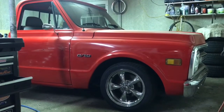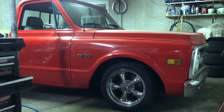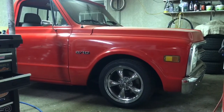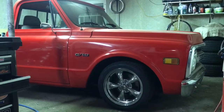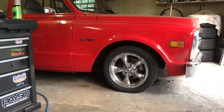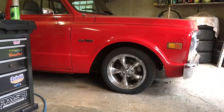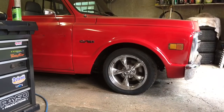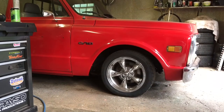The plan for the night is to leave it bumped up in the front and in the back overnight. Hopefully when I come out tomorrow everything's sitting exactly the way I left it. We tested for leaks on the bench, but once everything's installed that's when you really get to test it. And here we are the next day — the truck is still sitting exactly how we left it. No leaks in the bags, and the tank's holding the exact same pressure, so no leaks in the tank either. We did alright plumbing it.